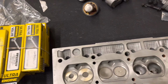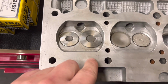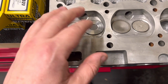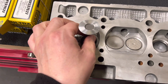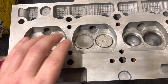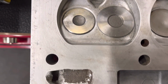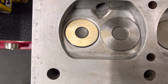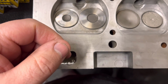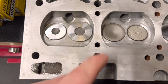So here's the valves for Carlos's cylinder head, and here it is. See, we've got two of the new ones. We've just put them in place for the minute. Obviously, as you can see, the inlet is sitting high because it's sitting outside the seat. We've got to put them in and trim them down a bit. Looking at the inside, it's the sort of right shape really. If you look at it compared to the old ones, you see they are quite a lot bigger. And as I planned, we've got about 1 mil gap in between both of them. So hopefully, once we've got our inserts in, which haven't arrived today unfortunately, we should be able to get them at the right heights, and that'll be perfect.